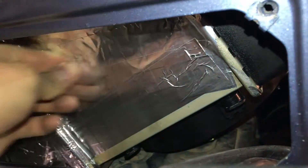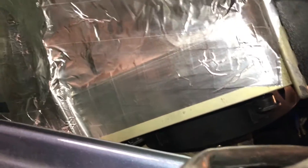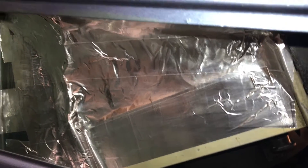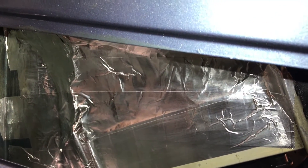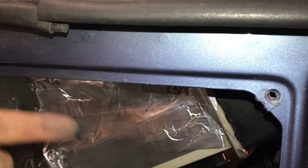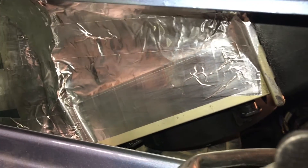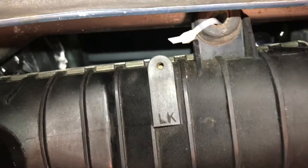Here is my taped-off intercooler. It doesn't look the prettiest but I think it's definitely the best option, at least in my mind. Other people kind of build a piece of sheet metal or whatever, but there are all these little air gaps. For me I wanted to keep this as airtight as possible, forcing as much air through the actual intercooler as possible. I started off by layering overlapping pieces of tape going one way, and then I put another layer going the other way so it encompasses all the open holes I might have missed on the first round.